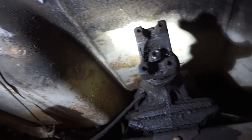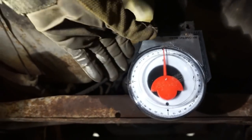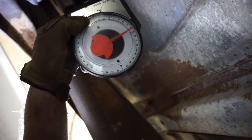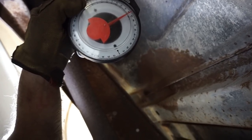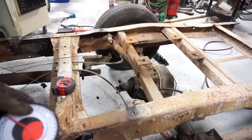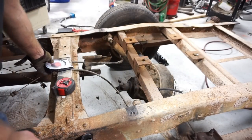Just for scientific purposes we're back underneath this truck again - sorry for the shaky video, I'm trying to roll around on a creeper with a big camera. I measure it out, level it to zero, and we said tell us your angle. The pinion is sitting right at 84 here - kind of interesting, I thought as the frame came down this might also come down. So the front is at 84 now, and the rear is sitting right at about 76 to 77 degrees.